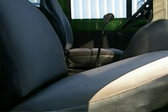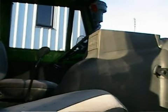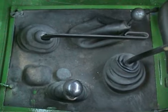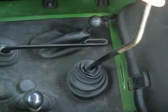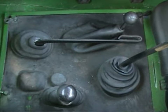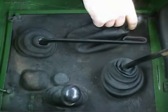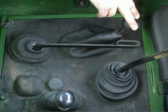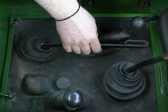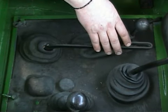Luxury velour seats and an Atkinson Vos rubber engine cover round things off nicely in the interior. This particular Unimog has the straightforward six-speed gearbox, which is the best gearbox for use on the road with the best speed ratios. Reverse is on one and two. PTO is operated by this lever here, and 4x4 and diff lock by this lever. All in good working order — it's a very nice gearbox.